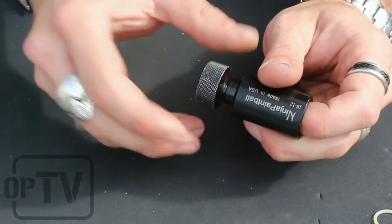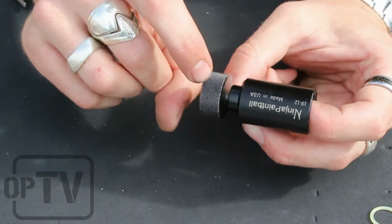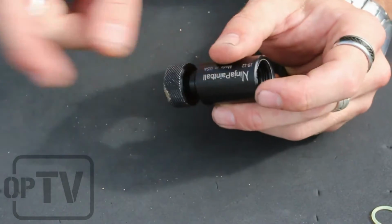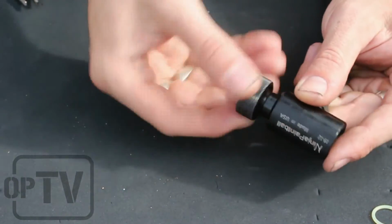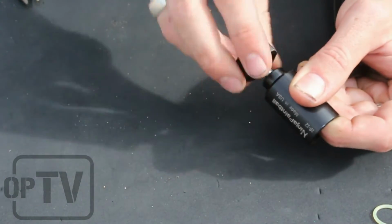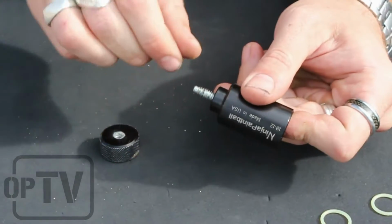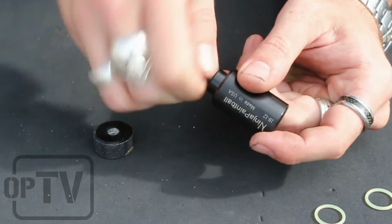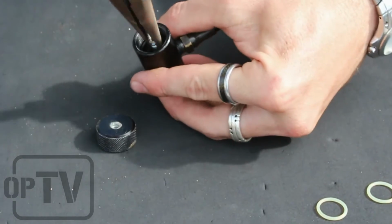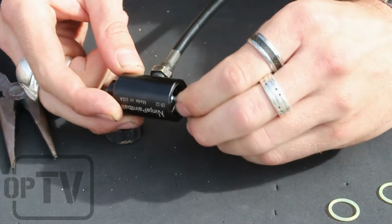Right, so check to see on the knob of the on-off adapter if there's a little Allen key. Some versions there's a small hole somewhere here, and it has a tiny Allen key which holds the knob on there. Other ones, they've changed the design now where they just Loctite it on there, so just open it up until it stops, and then just keep turning until you actually crack the Loctite off, and then this will come right on off. Okay, just like that. Okay, and then what you want to do is twist this pin back through. It's a little bit fiddly again, but I'm trying to just twist it through. Okay, and then the pin is going to come out now.